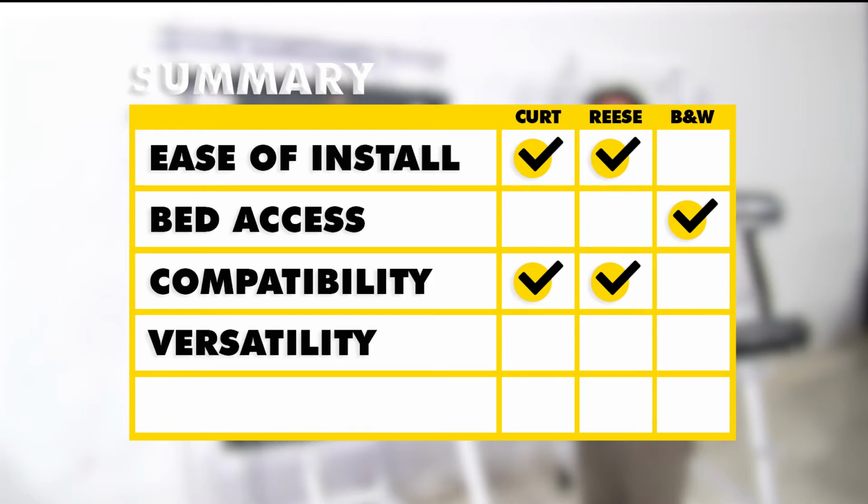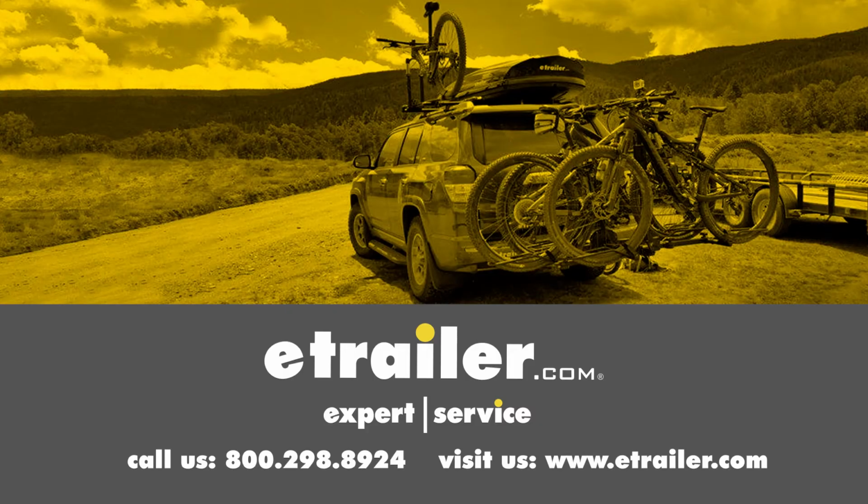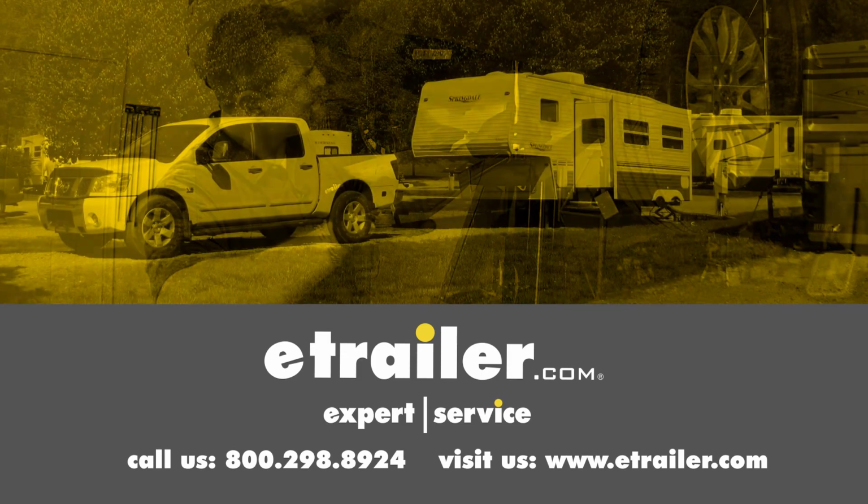Now as far as versatility goes, I think I'm going to have to give it to the B&W because the mounting kit does double as a gooseneck trailer, and it does work with the companion fifth wheel hitch. So if you have the companion fifth wheel hitch and a gooseneck trailer, it'd take less than 10 minutes and you can convert it back into a gooseneck. As far as storage or the hitch connection and disconnection, I think the B&W is going to win because there's only 1 lever as well as 1 bolt that you have to loosen, and then your fifth wheel will come out. And that'll finish up the look at the best fifth wheel options for your Ford F-Series.